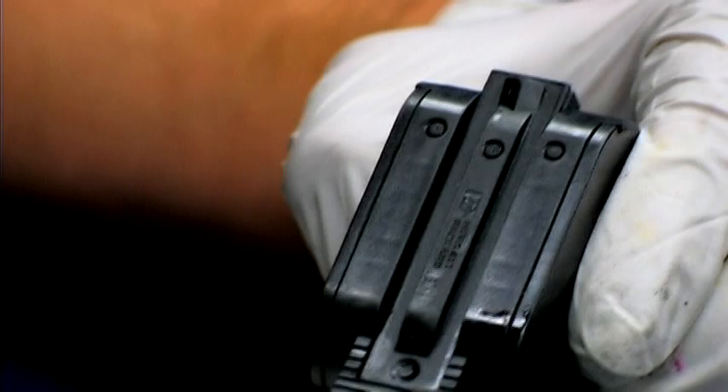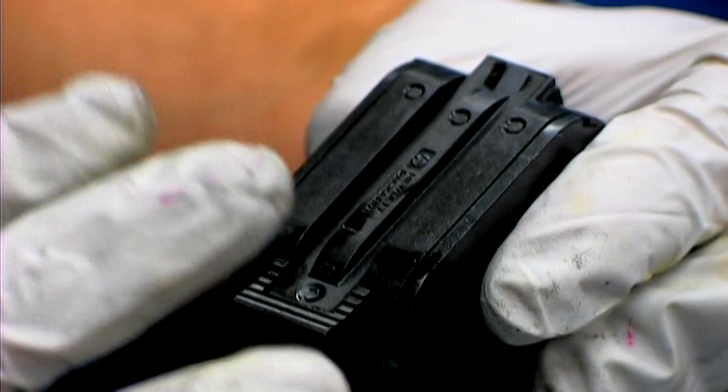Inside all of HP's printhead cartridges — make sure it has a printhead on the bottom — inside all of these there's just a sponge. So when you inject the ink, stick it mostly all the way down to the bottom and inject. That way you do not get any air bubbles.